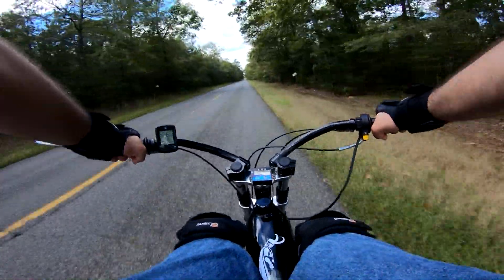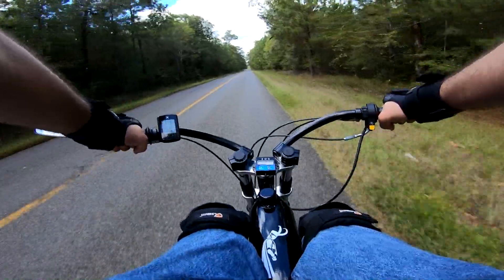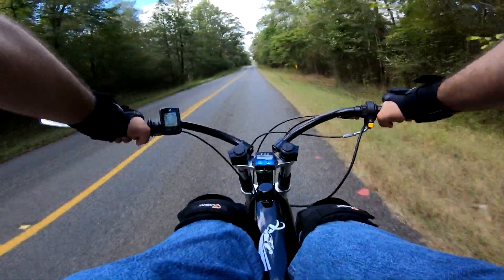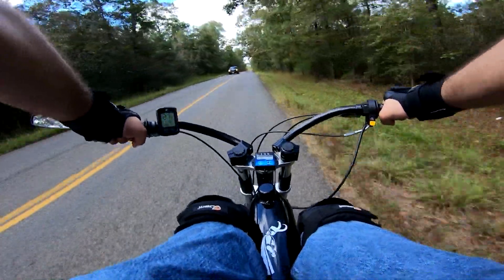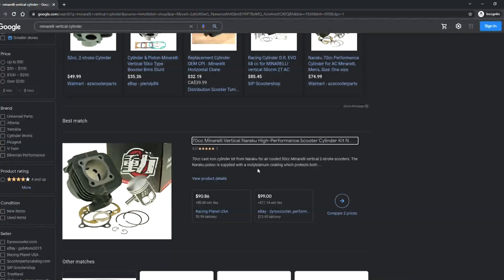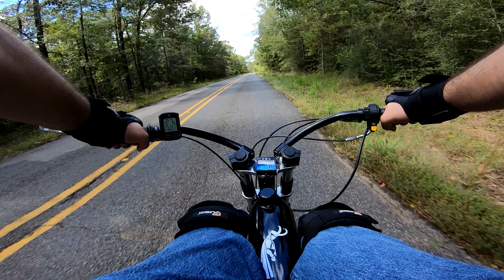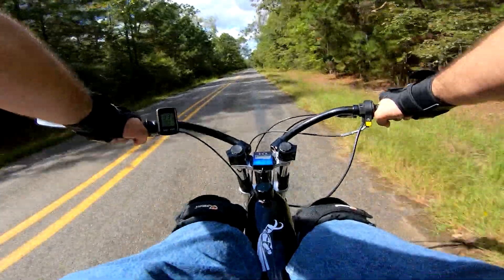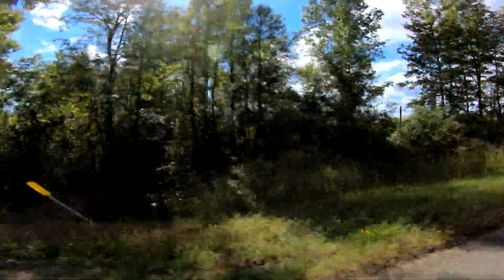These kits are more relatable to DIY tractors than they are to actual motorcycles — only intended to get the job done, with top speed not only being the least prioritized element of their design, but purposefully ignored. This is only the surface level explanation as to why these motors may seem underpowered. Many builders know, and you will too soon in the series, that something as simple as a remapped port design could offer considerably more power. Just knowing that a high-end scooter motor with the same or even less displacement will almost always outperform a motorized bike kit may have you asking: why didn't they just cast a more aggressive port map for these kits? Surely something as simple as changing the cylinder mold would be a small price to pay for a motor that offers more power, right? After all, it's not like they would be using more material or labor, and more power almost always appeals to the consumer.